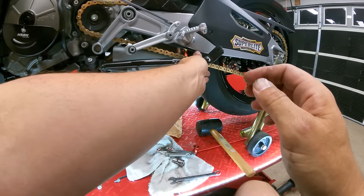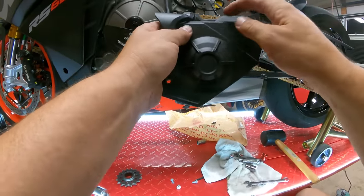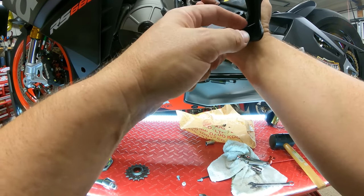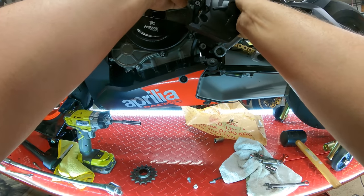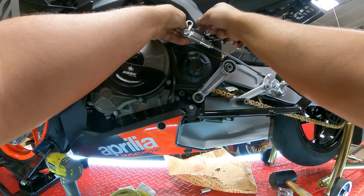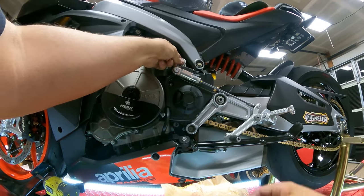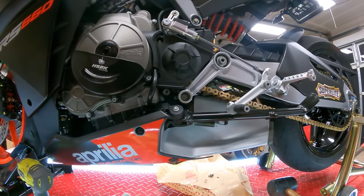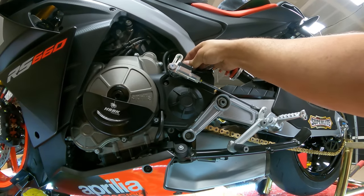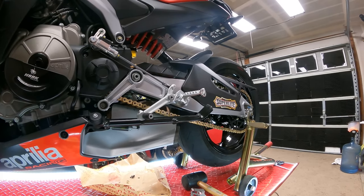Let's go ahead and get the front buttoned up — remove this cover. It's a little tricky because you've got two wires that go through: one is your quick shifter, and then you've got the hose that lines up through here. We're just about buttoned up, got all the bolts in, lined this up, and can get the little nut threaded through and tightened up. Let's take a final torque spec on everything and then do a final look and get you guys an outro.